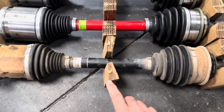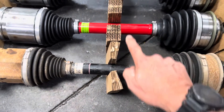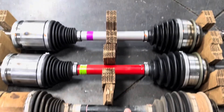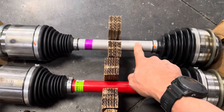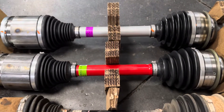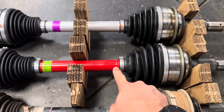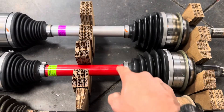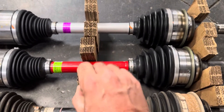When we measure the axle size, we're one millimeter larger on the red than we are on the black. And we are one half millimeter larger on the silver than we are on the red. But if you measure right here where the flange is, we are the exact same size on the axle. So the axle part in between here, it is a little bit smaller in diameter.